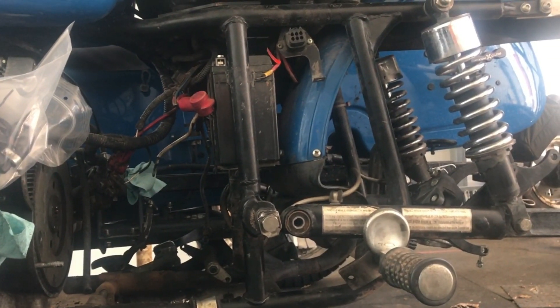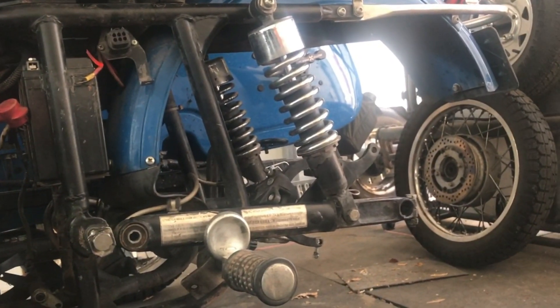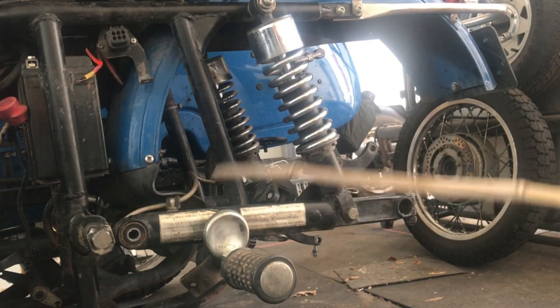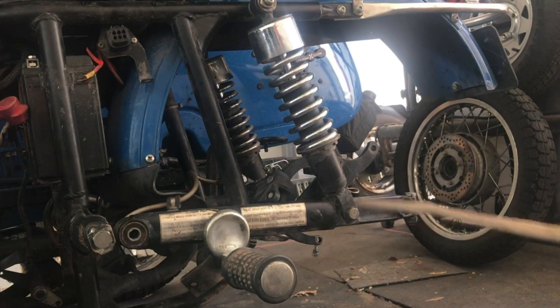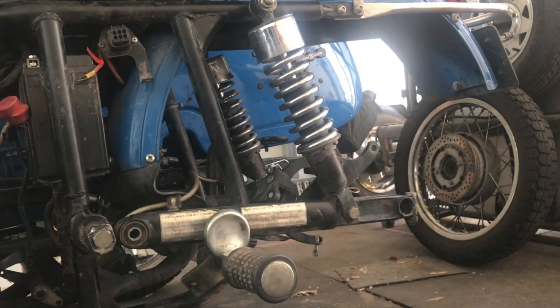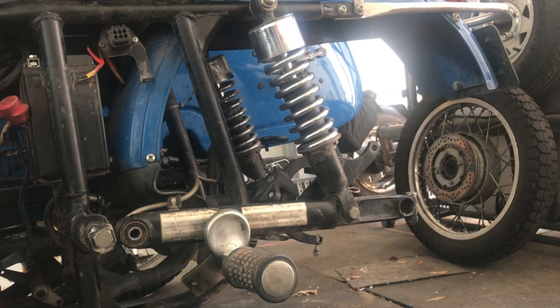I did this, as you can see, because I had to remove my gearbox — I lost third gear. But just moving the swing arm back that little bit gave me plenty of room to pull the drive shaft back, remove the donut, and get the gearbox out of there. So again, pulling the swing arm back to do any maintenance on the donut or to get the gearbox out, you don't need to remove the shocks — just leave them on and pull the swing arm back.